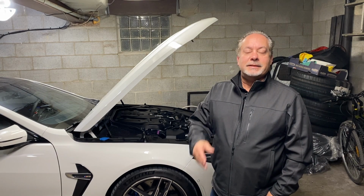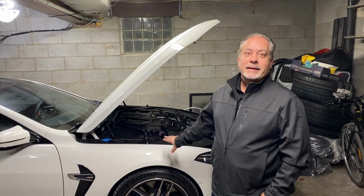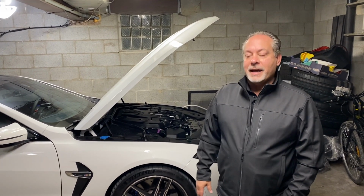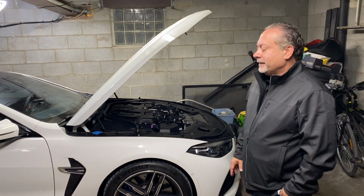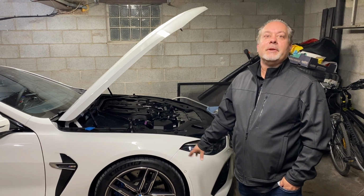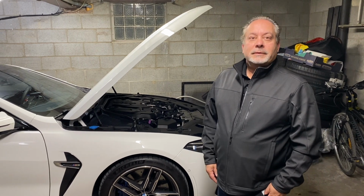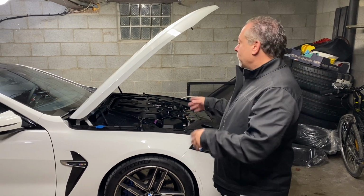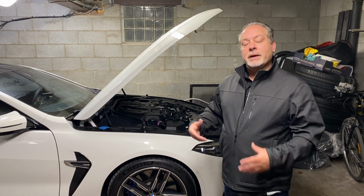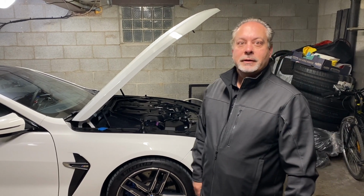We did a 60 to 130 run in the high 7s, which when I did that stock, it was in the high 8s. So that's pretty substantial. Especially with it being 32 degrees outside right now. I'm on summer tires, and the tire temperature was only at 59 degrees, so there was no traction whatsoever on the road. So it's going to get better. Oh, absolutely. And we were only in the stock setting. I can go up 2 more clicks, so get more power. I actually think if I would do the Michelin all-season tires, I would have a better 0 to 60 run out there.